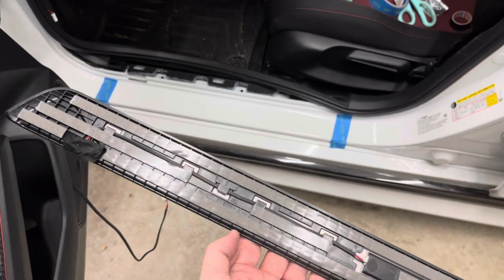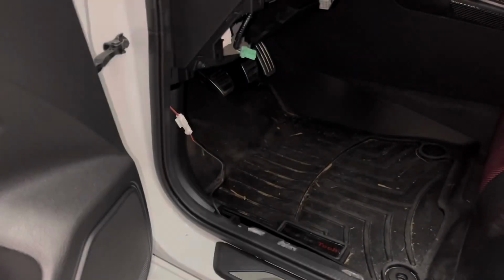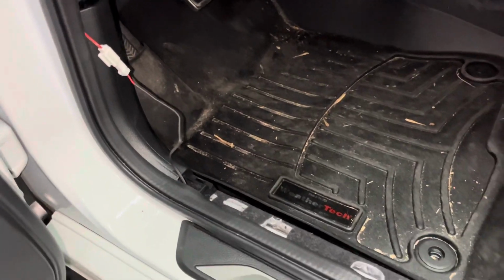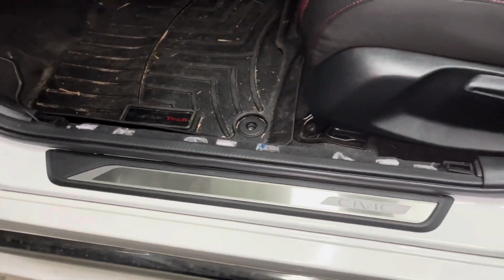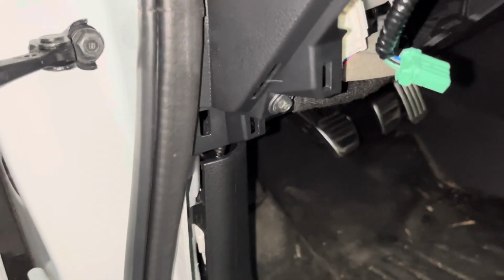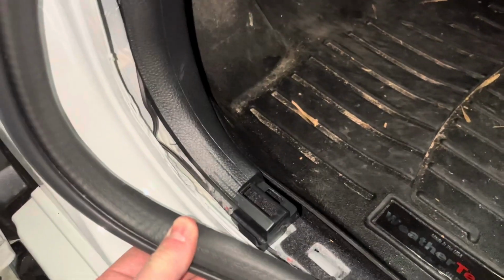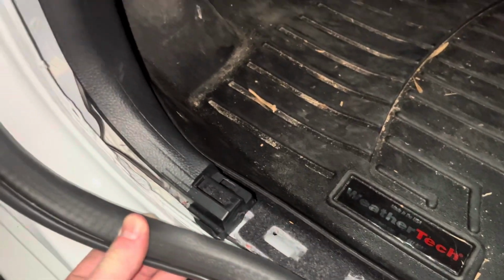Clean the bottom of the door with one of the alcohol wipes included with the kit and peel the tape backing off the bottom of the door sill. Lay the door sill in place and press firmly going over the entire door sill. The door sill wiring will run over the aluminum tape section and up the side of the kick panel into the main wiring harness. Reinstall the rubber door seal. This will hold the wire in place.